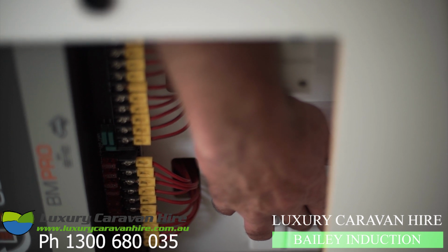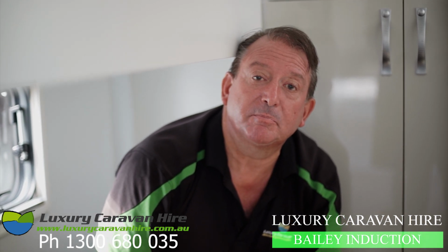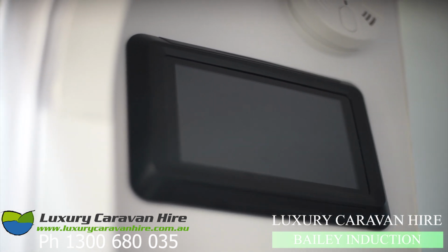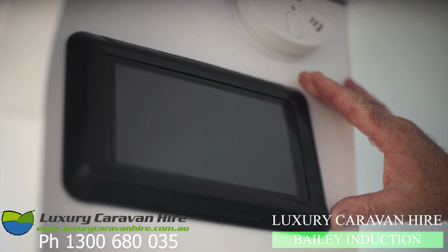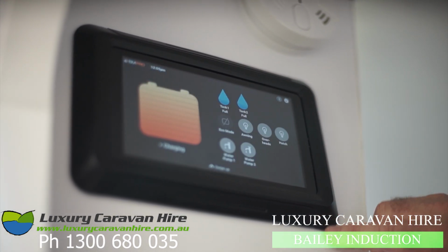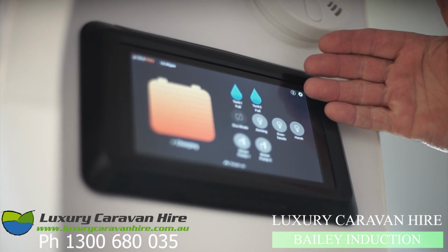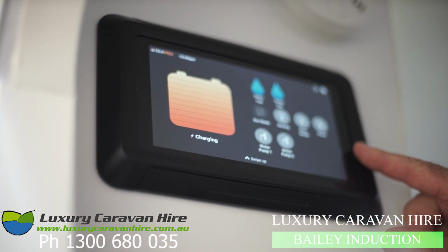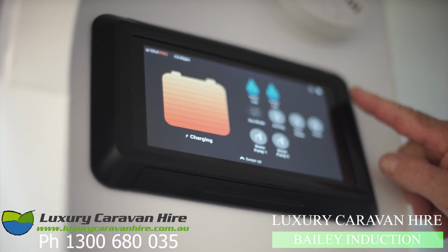Okay folks, so we're still in the Baileys. Now, all the Baileys have the same features. Sometimes they're just in different places. Okay, so we've turned on the master power. Directly above the cupboard for the master power you'll find the LCD screen. Touch the LCD screen to activate, and this now allows you to do a whole lot of functions, including check the charging rate, turn the water pumps on and off, turn lights on and off, etc. And directly above that, our smoke and carbon monoxide alarm.